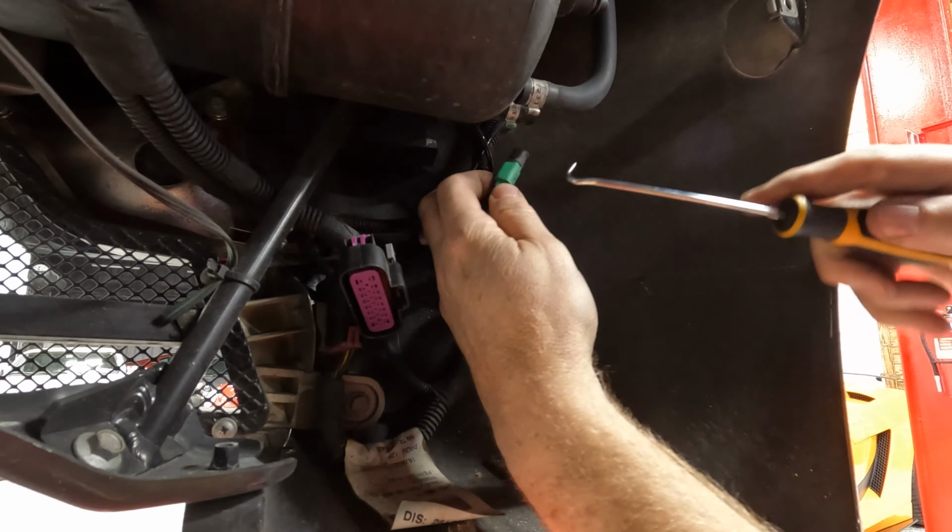Okay, look at that. There's glue on this thing. How am I gonna get that? It won't go through. Let me think about this one while I put in some of the others. I might have to try and heat it up. All right, so what I did is I put it in a vise and put some heat on it with a blowtorch. It burned off some of the glue that was sticking to the bolt, and I was able to separate it. That wasn't too bad at all. Got it back in there. Now we can do this again. Let's put that one in last though, because I have a feeling it's at its limits. Time for the bumper. Sucks doing it by yourself, but it's not impossible.